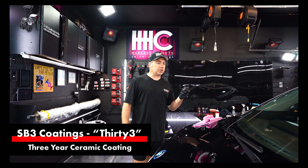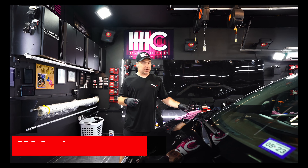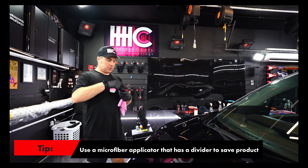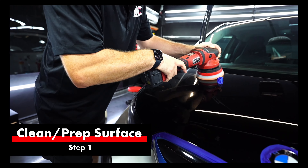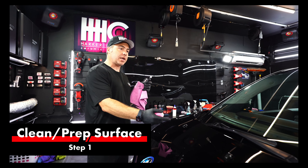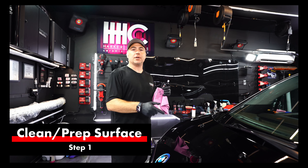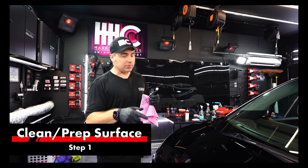It's really easy to use, and I'm going to show you how. We always use Auto-Fiber saver applicators and we level with Auto-Fiber quadrant wipes. For surface prep: we clean the surface — in this case we compound and polish the surface, then use SB3 Ready to wipe it down. SB3 Ready is a critical step to make sure the paint is ready to accept the ceramic coating. You don't have to do a paint correction every time, but you do need to do a panel wipe. SB3 Ready is your choice there.